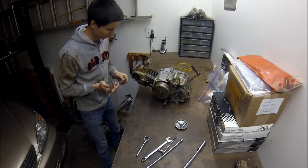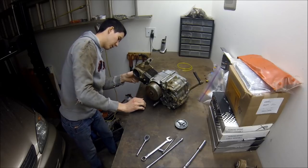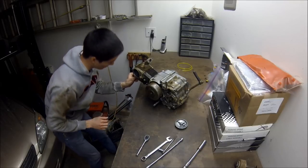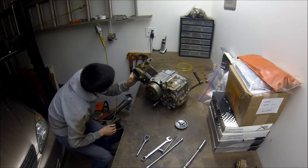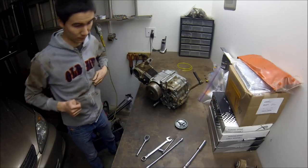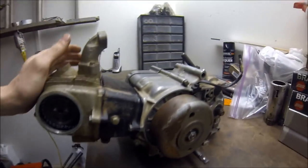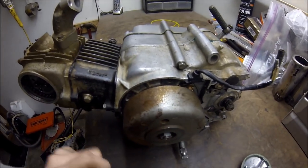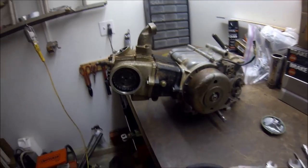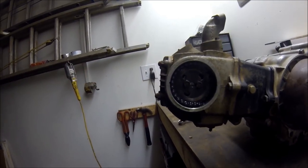There's no clearance on the intake side. There's a heck of a lot of clearance on the exhaust side — I suspect a bent valve. The exhaust valve is more likely to bend. The T is lined up with the notch in the crankcase, indicating top dead center on the crank. And the circle mark is lined up with the notch in the head, indicating top dead center on compression.